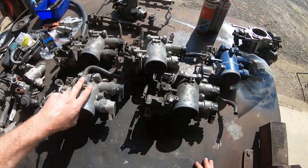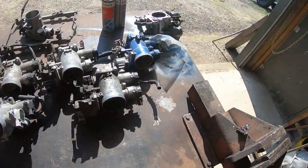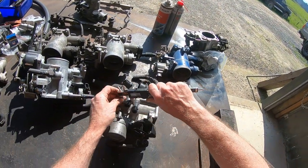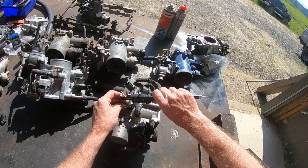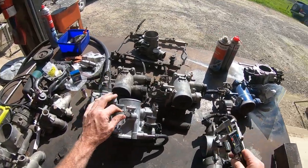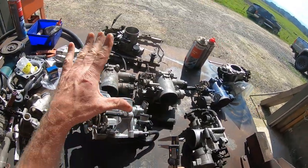On the bottom side there is a dampener which just slows down the throttle closing. The breather is on the bottom side of these throttle bodies. It measures up at 18 so that'll be a 19 millimeter, and on this one it's 10 millimeter - that's a gen 2.